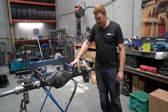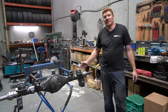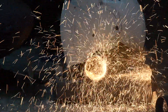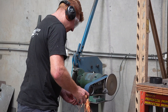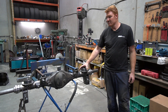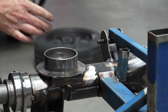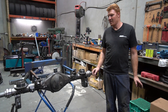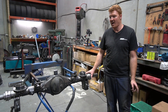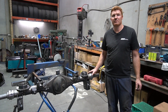After we bracketed the diff last time, we've had all our brake componentry come into stock now. Since we've got axles, bearings, retainers, ends — everything now. So tonight we'll be putting ends on the diff and also finishing the fab on our spring locators. We're trying to replicate the factory spring locator but thick enough to kill a ship. Hopefully we'll get it to a stage tonight where the brake brackets will get tacked on, because the diff is a little bit shorter than the factory. We want to make sure our brake caliper clearances are good first. Nico can take the diff away after tonight and bolt it into the car to check all the clearances.